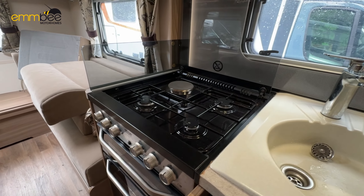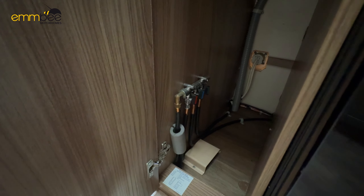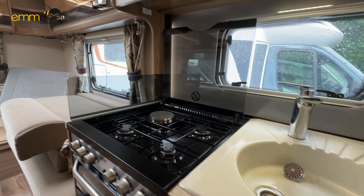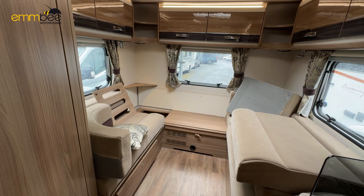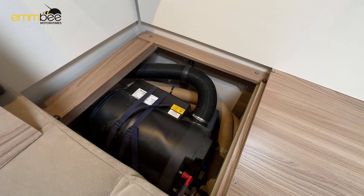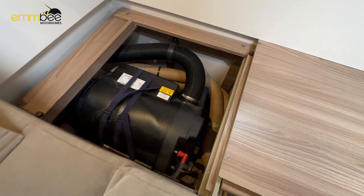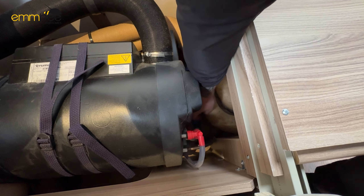Next we have got your grill and oven, and then your three-ring gas burner and one-ring electric. As you can see, it's got a glass cover — we recommend leaving the glass cover up after using the hobs. The reason for this is because of the temperature difference in the glass and the hobs; if you put it down straight away it could shatter. We recommend leaving the glass cover up for around 20 minutes to let everything cool down. At the same time you have primed your water system, you want to prime your gas. All you need to do is switch your gas tanks on at the main source, turn the nozzles, and use the igniter. Once the gas comes through on all of the rings, that is your system primed.